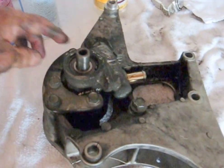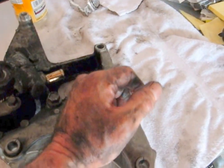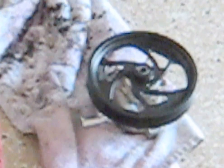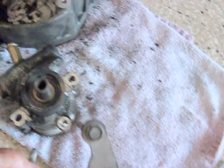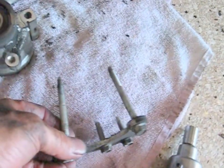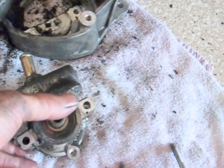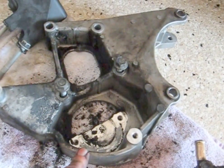The old power steering pump has four bolts. I'm going to take this off and then I think what I'm going to do is put the bracket back in first. The new pump has a pulley with openings in it so I'll be able to attach the power steering pump bolts by going right through that pulley. There's a bracket that holds the pump on. Take your old pump out and now I'm going to clean up this big bracket that holds the alternator and the power steering pump.